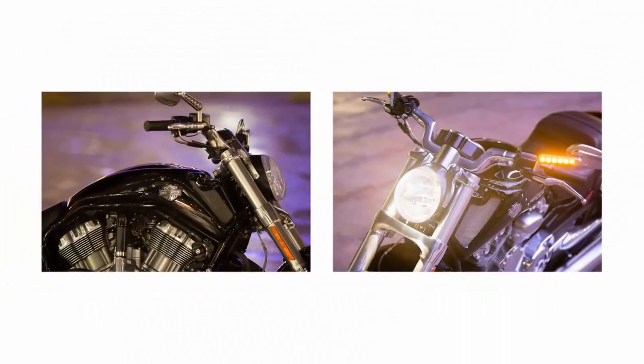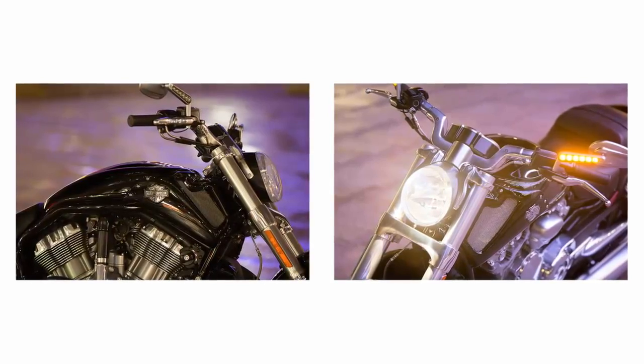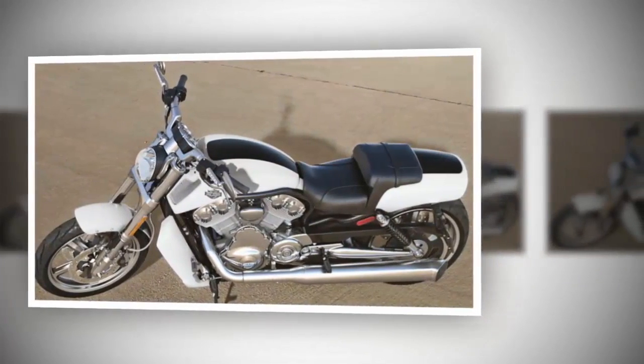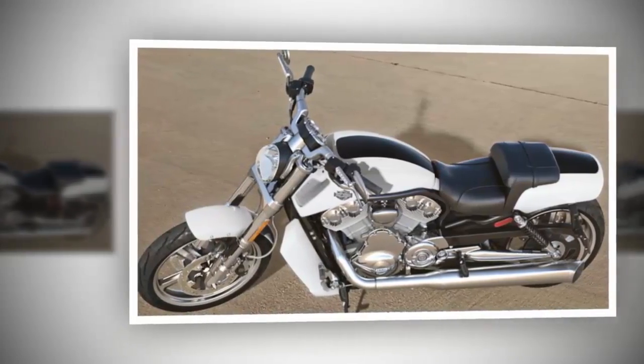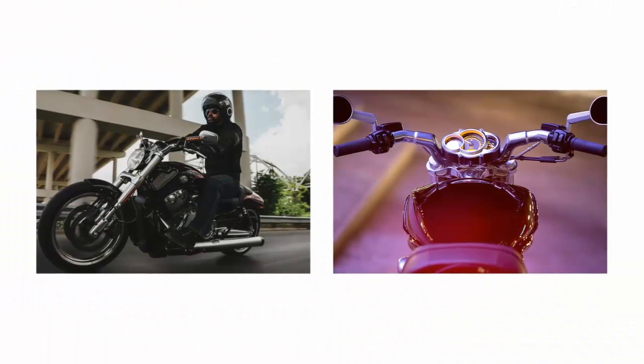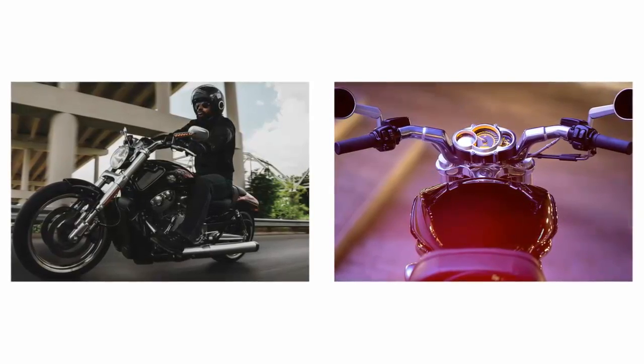Chassis: big and beefy 43mm front forks add to the already chunky and mean look of the bike, while providing extra strength and stability and lowering the unsprung weight on the front wheel. Black cast aluminum wheels help keep the weight low, and they mount the Michelin Scorcher tires for maximum traction. Speaking of traction, the huge 240mm rear tire provides plenty of it. Dual front Brembo brakes and a single in the rear, of course, handle the braking stresses, and the ABS ensures that you can use this not inconsiderable braking power with confidence, even in adverse conditions.